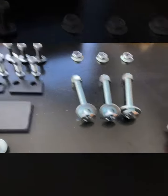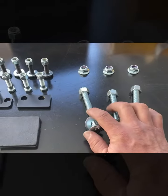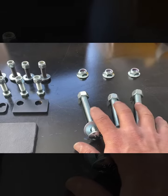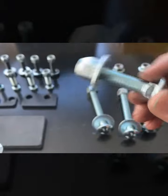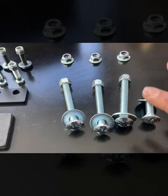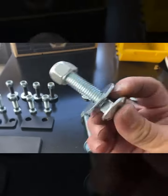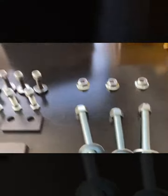If you have a 2500, the difference between the 2500 and a 3500 is: with a 2500 you get three of these longer bolts because they go through your wheels and through a plate. If you have a 3500, you get this shorter one because the 3500 wheel turns inside out, so it needs a shorter bolt. You'll have four of these for the 3500 and three for the 2500.